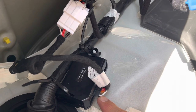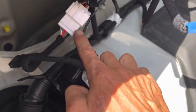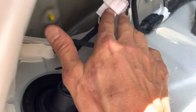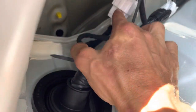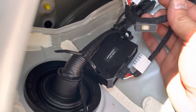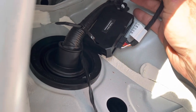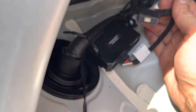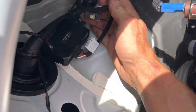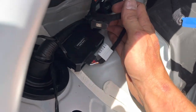Next will be clipping this wire, which goes to the factory harness, into this one. Run the wire behind this wire — it's always good to have things tucked back. Also, if you have an issue, this is where your fuse is located. If it stops working, check that first. It's important to make sure you can access it easily; otherwise you're going to have to tear everything apart.